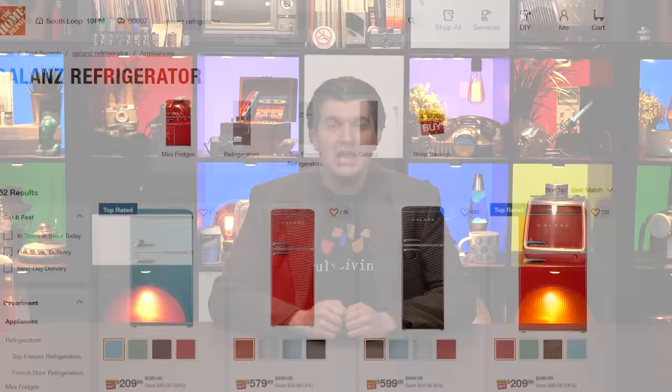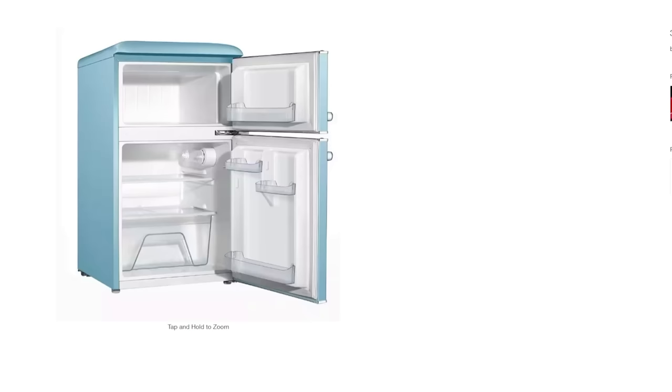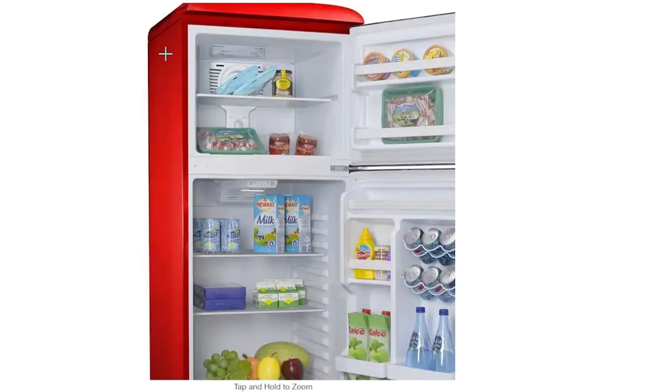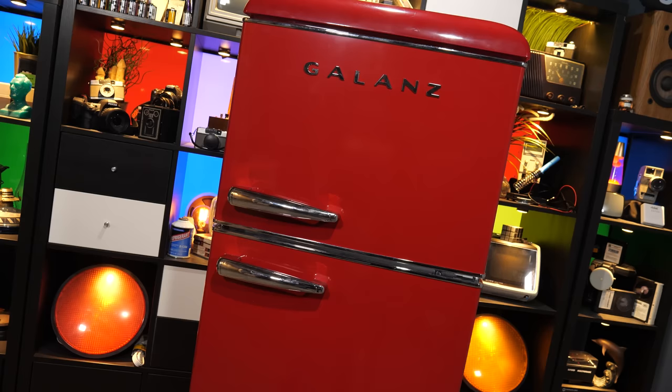But I've fixed it! And I'm happy about that! And guess what — the manufacturer seems to have fixed it too. They continue to make plenty of these silly retro fridges, but this particular model has been discontinued. They sell even smaller ones which appear to have more or less the same design, so if you're looking at getting one of those be wary of its thermostat — hopefully they ran the sensing bulb somewhere more sensible. But when we get up to the size that this fella is, they've gotten a lot more expensive because they got their wish to become a real fridge with automatic defrost and everything. We can even see the air pass through between the two compartments — the evaporator is now entirely in the freezer, and it just lets some of that air fall into the fridge when required. However, these new offerings have gained pretty much all of the complexity of a modern fridge, which is probably mostly a good thing, but I still really admire how incredibly simple this design is.